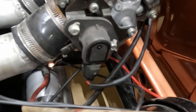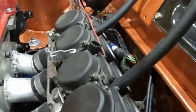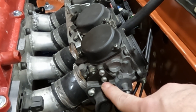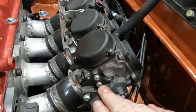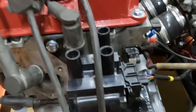I've brought the cables in through the bulkhead and I've got the three cables. We'll start with the throttle position sensor, which tells the ECU how much the throttle has been opened. The fuel comes in via the fuel pump mounted at the back — these are just carbs so there's no injection. As we open the throttle, it pumps fuel straight into the engine, but we need to know how much it's open so we know when to fire the coil.